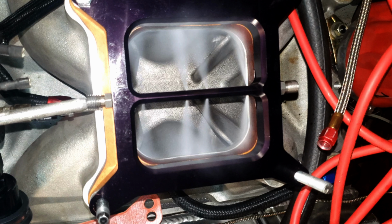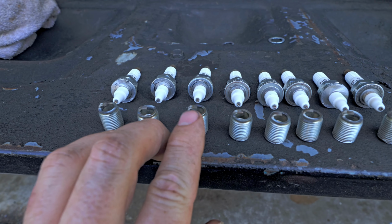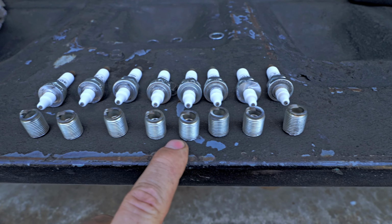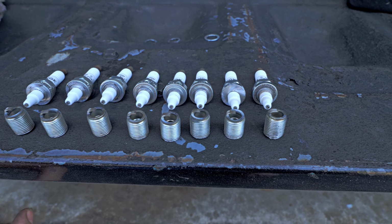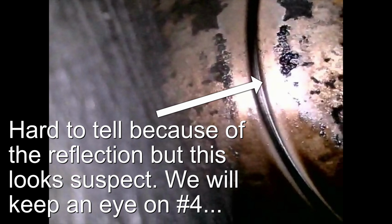For E85, it's very important that you get even distribution and that you really pull your plugs, make sure everything's looking good. You're not nipping anything. You'll start to know, some of these little straps start to get nipped and you start to burn back. Well, you got too much timing or not enough fuel. And that's what you gotta look out for. And you might as well, at the same time, like I'm going to show you guys, I'm going to put a borescope down the hole and I'll show you how to look for nipping on your cylinders. Because in the past, I've been really good at nipping cylinders and messing things up on nitrous. Because that's how you learn. And like I said, I'm learning with E85. And like I said before, I don't think I'm going to run any E85 straight in my motor right now.